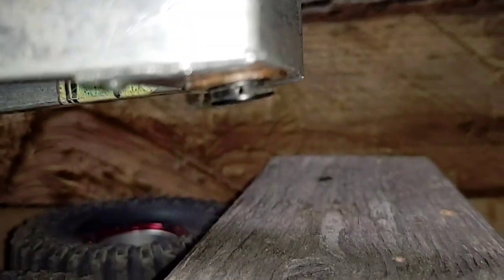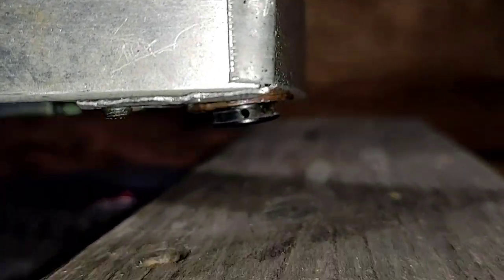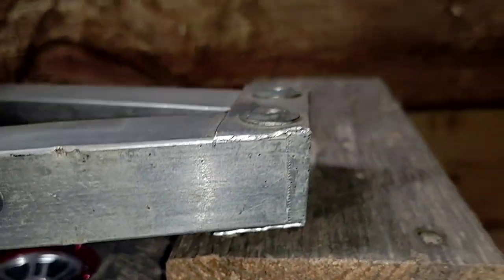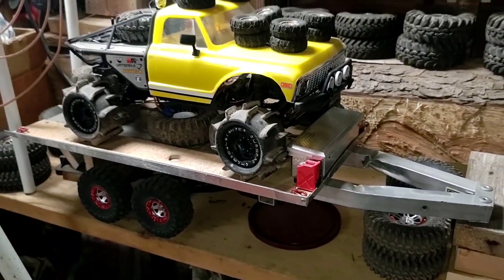It's held in place with a couple of long grub screws going through the upper portion — those are the grub screw mounts that hold that cup onto your axle pinion. Right now it's just holding it in place inside the trailer, and that essentially is a recessed trailer hitch. You just slide this cup over top of the ball, then use a hairpin to put right through that little hole and through the top of the ball — it pins everything together. Works out very well, super flexible, and extremely tough for going off road.